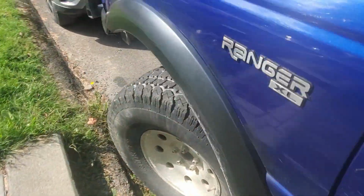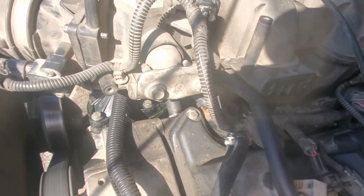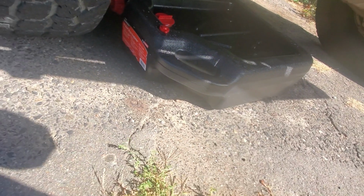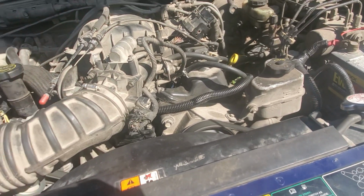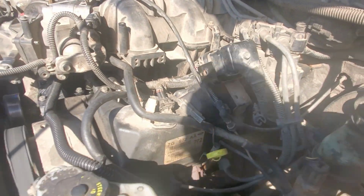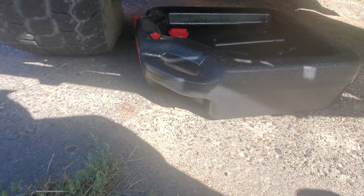Good oil pressure, so that's good. Sounds good too, you don't hear no ticking or nothing. Sounds pretty good. Last time I could see it leaking from here. Kind of hard to tell with all the crap I spilled. Well, sounds good. You can hear the injectors clicking away, but I don't hear no timing chain rattle. I don't see nothing dropping into the can either, so it's probably pretty good.